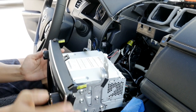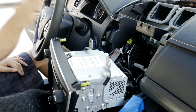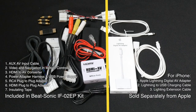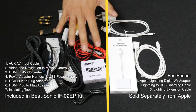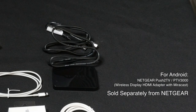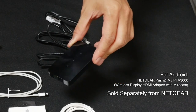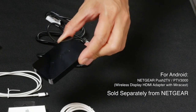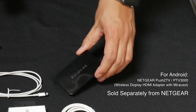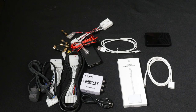Let's grab our adapter — our mirroring interface adapter — and we are going to plug it back here. The following are the components included with the IF-02EP kit: everything you see on this side of the line. If you wanted to mirror an Android device instead of an Apple device, you will need to get a wireless phone mirroring system such as the one by Netgear. It works great — we have tested it. Unfortunately there are no wireless mirroring systems for iPhones that we could find.